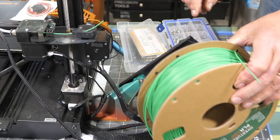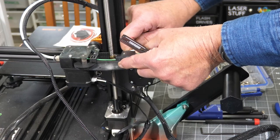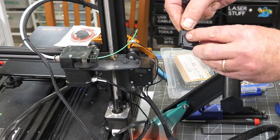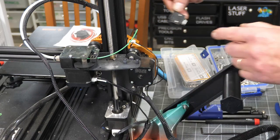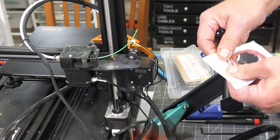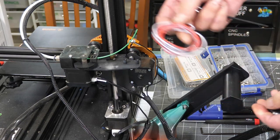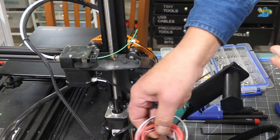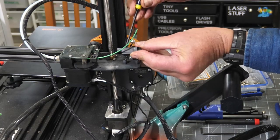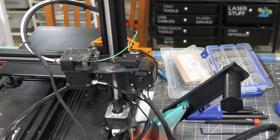Now I need to replace this sensor. It's actually pretty simple to do — especially on this one, I've done it a few times already. I'll just unplug the cord, slip it out of there, and don't lose the screws because you'll need them for the new one. You can see how bad it wore through — a lot of people don't realize it, but filament is actually abrasive. These are not expensive. I have a little stock of them from Amazon. The replacement does come with a wire if you're adding this on. Something to keep in mind: there's an arrow on the sensor indicating the direction of travel, and you've got to get it lined up on the standoffs. Then it's just a matter of plugging the little connector back in.